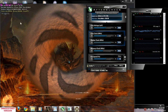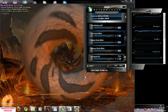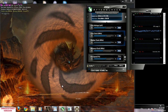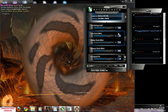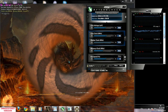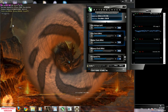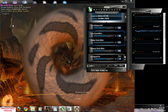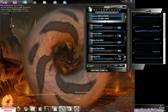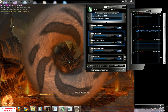By artifacts I mean different colored lines appearing on screen or freeze-ups. I'm running the test now at 760 MHz and my temperatures are good. In actual games the GPU temperature will be a little bit lower than during this test, but I love this test because it brings your video card to its knees, tests its maximum potential, and generates maximum heat — which is exactly what you want for stability testing.